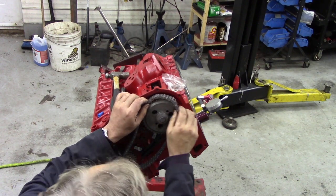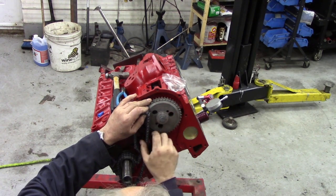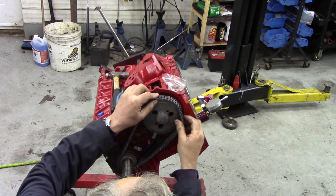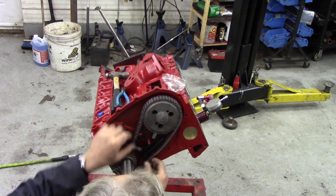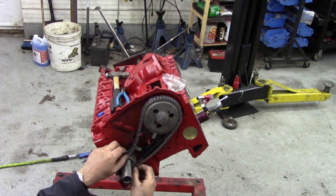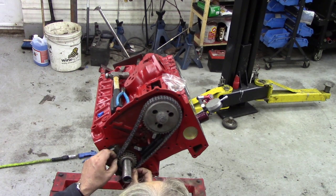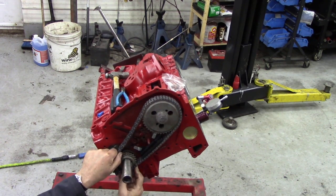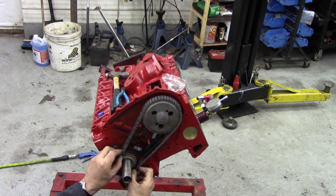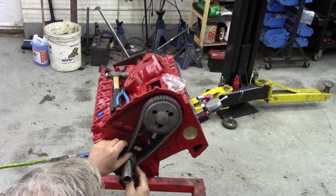Put the chain on first. What we've got to realise is that the little mark here lines up with this bolt hole — the centre of this bolt hole — all the way through to the centre, with this on top dead centre. So we can't really go wrong. We'll put that chain on like that. We need to get that tension just about right — that's too far — let's take it one tooth. That's good. It's sort of eyeballed everything up on this job.